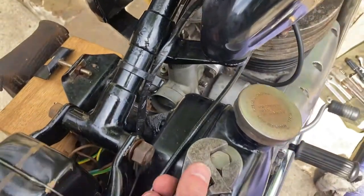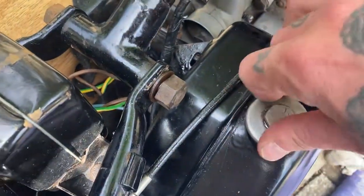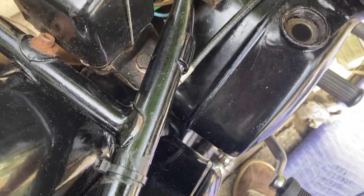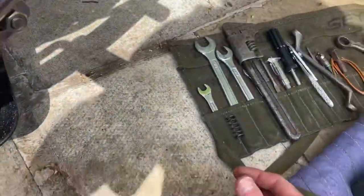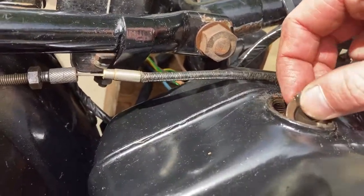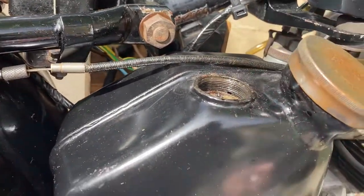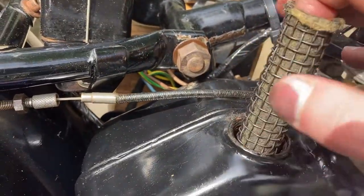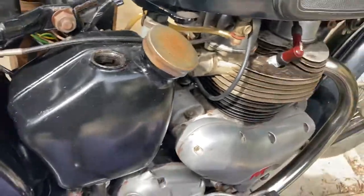So what we do is we get a spanner on there, give it a crack, and then it's got a spring underneath it so you just have to keep a bit of pressure — that's it — so we don't lose that spring. Pop that to one side. I'll pop it on my tool roll there so we don't lose it. Then if we very carefully take out this — this is like it's just a cup for the spring. Pop that to one side too. Get your finger in there and pull that off, and that manky looking thing is the old oil filter element.